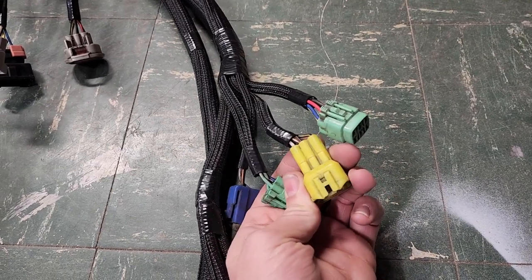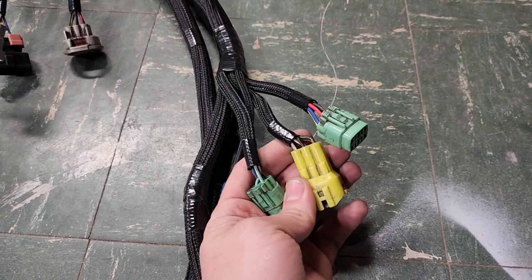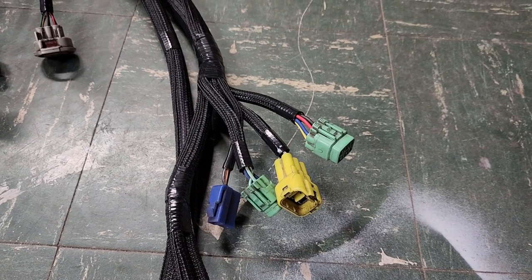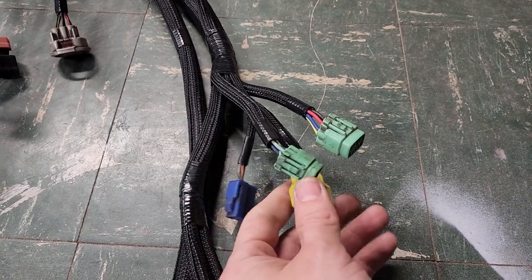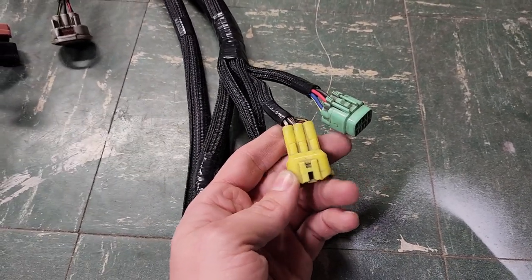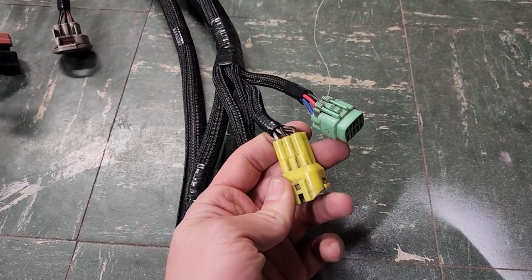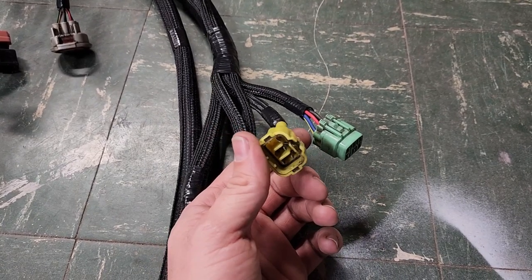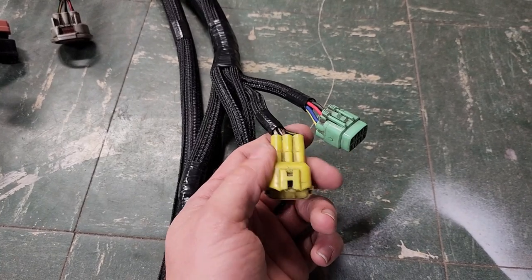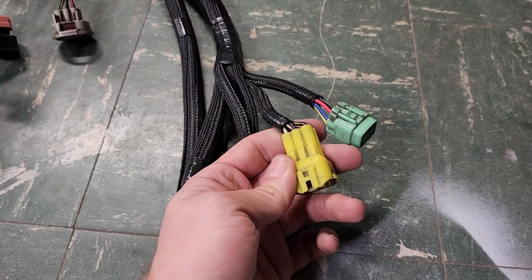The C1 connector is a six-pin that connects to the front engine bay harness at the fuse box. It carries the EFI main power — B-positive black with red stripe — the MREL signal from the ECU to turn on the EFI main relay, the battery constant 12-volt to the ECU to maintain codes after key-off, and some hazard horn wires. This connector was updated in the post-89s and is not compatible.